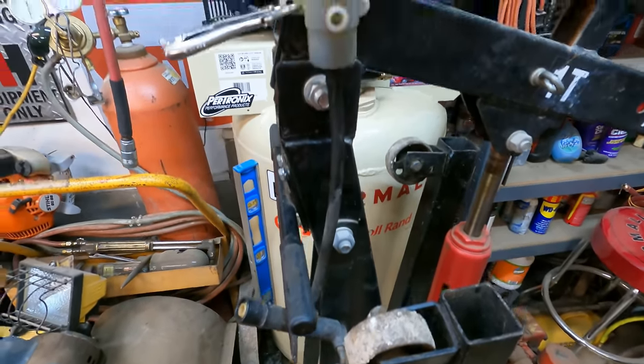So I'm up here troubleshooting wiring for at least an hour, just to find out that the former owner had bypassed the inertia switch here on the floor, which is these two wires here, and he just had them twisted together. So I cut those off fresh and put a nice butt connector on there. And lo and behold, you turn the key and the fuel pumps run. So now, nearly instantaneously for you, we get to see this thing fire up. But it's been a long, hard, annoying road for me.